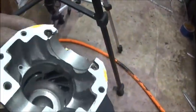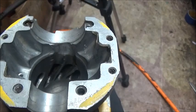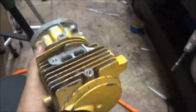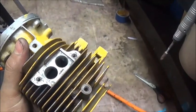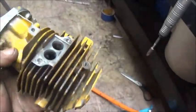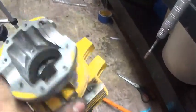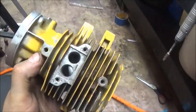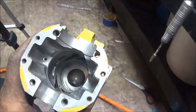If you want to go back and look at before and now, these things have been drastically worked over, and I'm going to be that asshole that says you're not going to replicate that with a Dremel flex shaft and some carbide cutters. You end up just wrecking your cylinder trying to do so. I spent a lot of time with the right angle handpiece, as well as all different sizes of cartridge rolls and deburring bits. May not look like it, but I did, and you'll probably see how strong this saw is before you ever see this video anyway.